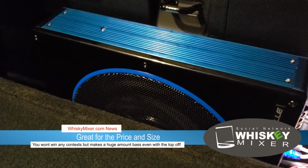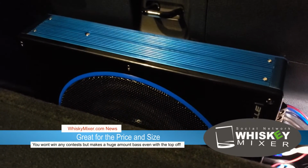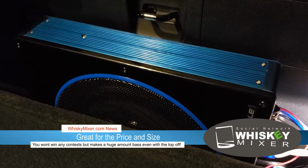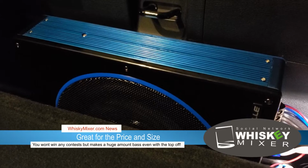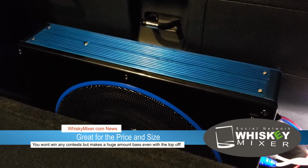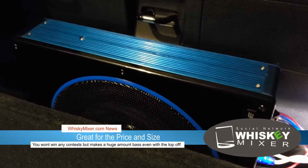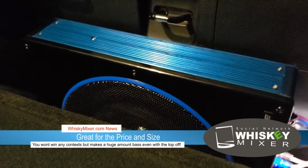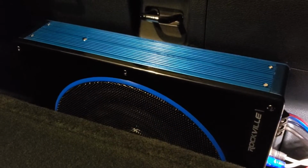But make sure you buy an active, powered, high to low output converter. If you don't, which is what I started doing when I first put it in, you're not going to see the results that you're going to want because you can't tune it separately from the radio. So make sure you purchase that. Once we installed that, it lit the thing up. Actually, the people that helped me install it were completely surprised at the difference it made. For like $15 you can get one, and that is something else I'll put in the description.